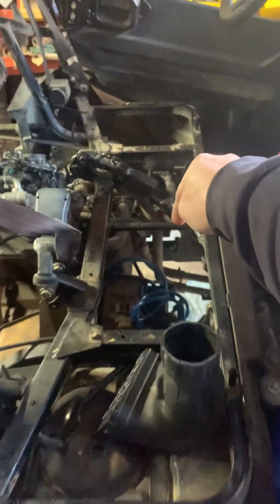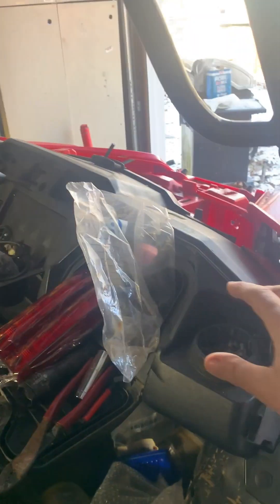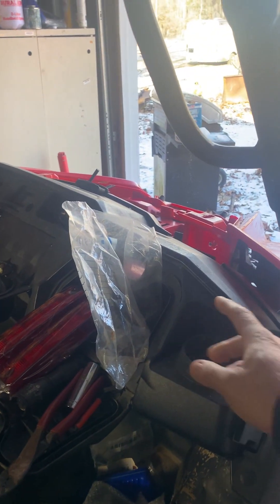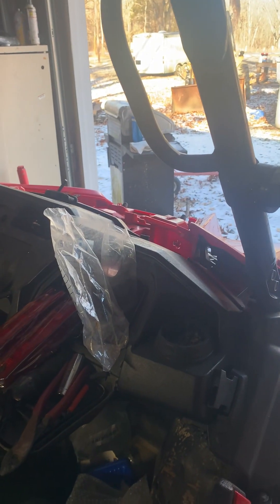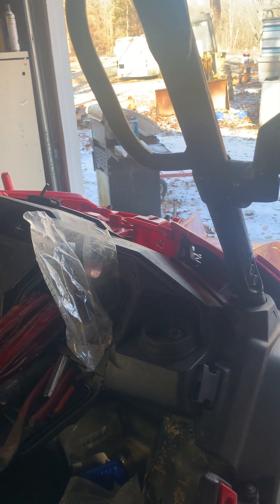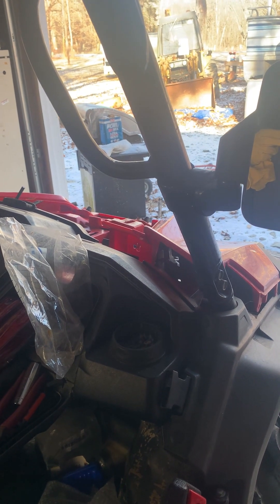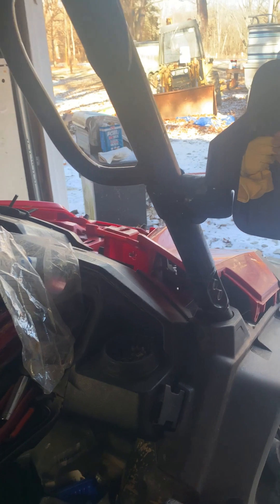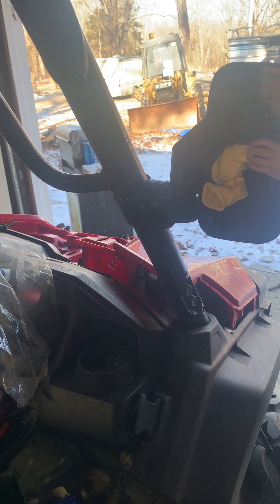So I'm going to take a piece of hose running down following the factory line underneath here, and bring it up. Super ATV makes a snorkel kit where they remove the cup holder and run it up along your pillar. We're going to try and do it homemade, so stick around and let's see what we can do. It's awful cold here so I'll pop on to the next video when I get a little bit going.